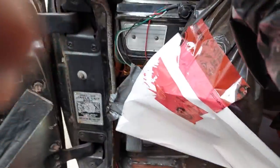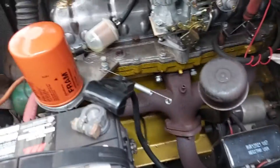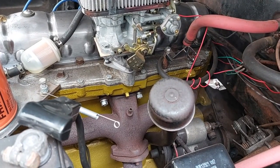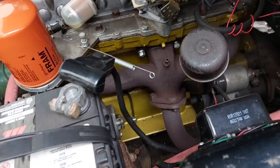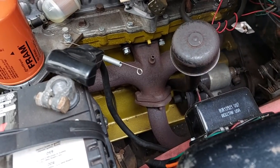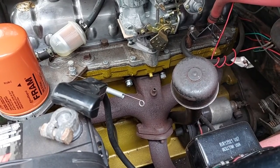the reason I was doing that with the engine is not just because I wanted to show off a little bit and rev the engine. I pulled all my spark plugs and they were all black. Apparently it has something to do with how much your engine is left at idle. I read all about it. There were a few different reasons why you could have black spark plugs, but one of them is that your engine is left at idle too long, and that's all this engine ever really sees, because they never drive it, right?